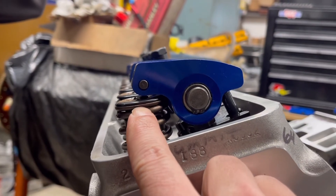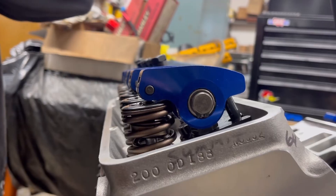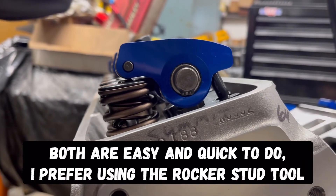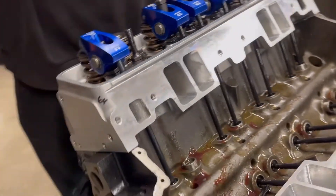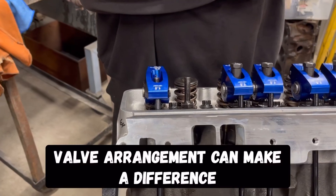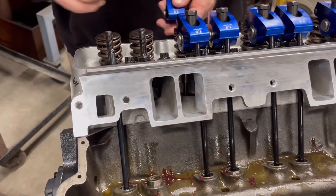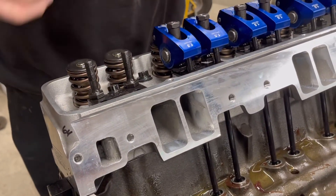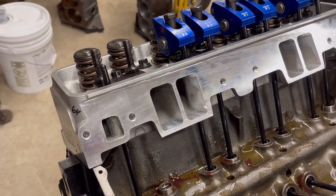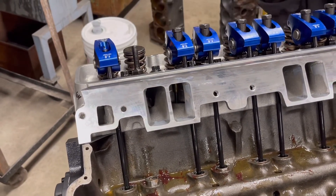Center your rocker as much as you can on the actual valve stem, run your tool just like we showed using the push rod checker tool, and you'll do your measurement like that. We've already done it and both methods came out the same — two methods to check your push rod length. Do it on both intake and exhaust, since some cams have different lift and some heads have different rocker stud configurations. Our push rods from Competition Products are Howard's manufactured — chrome moly, .060 wall, oil through. Our next step is going to be adjusting these.